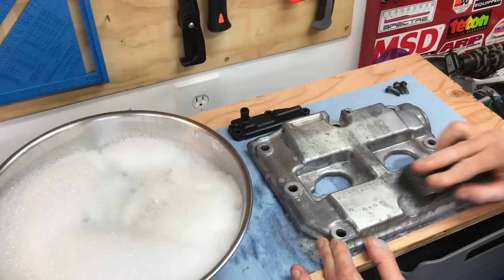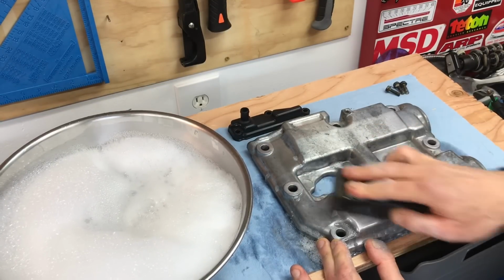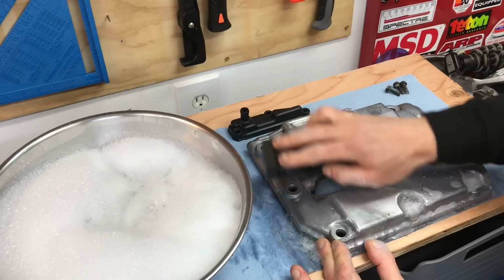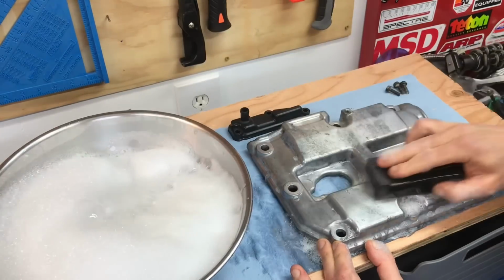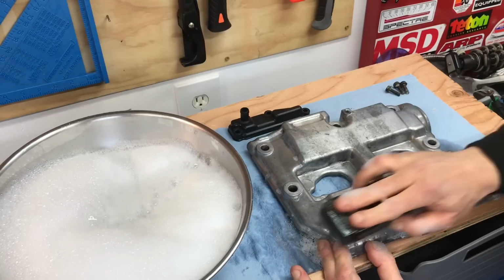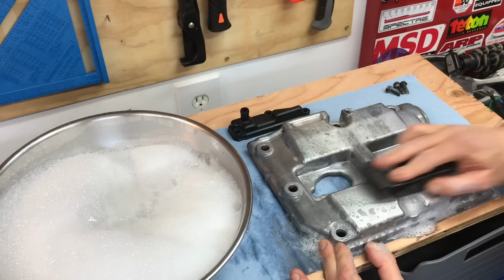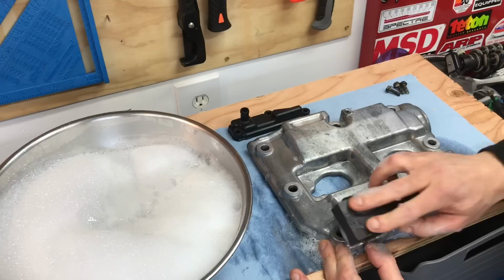Now, as you can see, I'm going in a horizontal fashion, but I'm actually going to mix it up and I'll start doing circles and I'll start going at diagonals as well. That's actually also the key to a good sanding job: you want to think about how the surface is being sanded down and think about all the ridges and all the valleys you're creating, and you want to make sure you knock down all those ridges in the most even way.